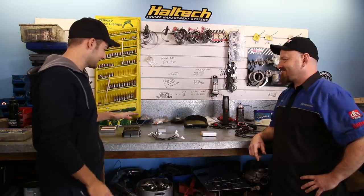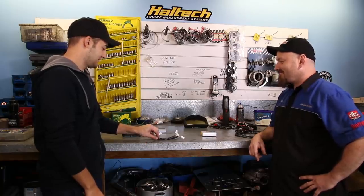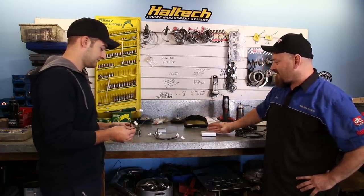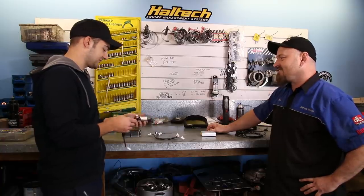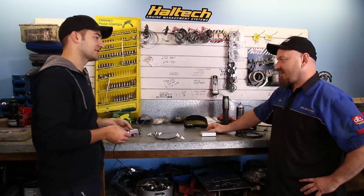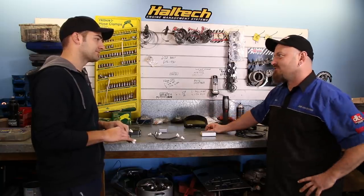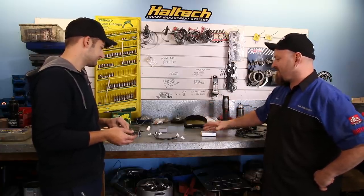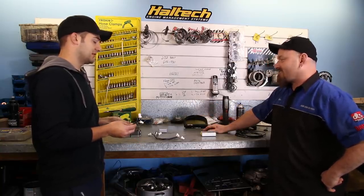I've laid it all out on the bench because it'd be good to go through what each bit does, as it's fairly complicated. A lot of your sensors go into separate boxes, and then communicate with the ECU via a CAN network. Rather than having one ECU with 500 wires hanging out of it, you can have boxes individually do one thing. It's user-selectable - if you don't need all those wiring inputs, you don't need to use them. If you need them, you add bits through the CAN network, which makes it expandable. This is also how lots of modern cars work - CAN buses. It's a pretty common way of communicating between systems these days.